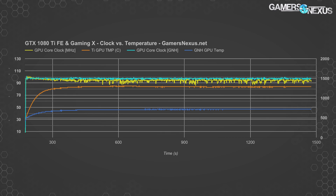Adding the GN Hybrid card — just an FE board with an EVGA CLC added — we see the Hybrid runs a GPU temp at nearly 45°C, where the FE card operated around 84°C prior to the mod. This could be resolved with a higher fan speed, but that's covered in our Hybrid results video. The Hybrid's clock rates are less spiky than the reference cooler version, which gives us the extra 4% to 9% performance in games we saw in our previous test, depending on how clock-intensive they are.